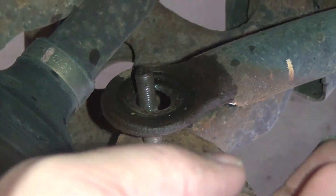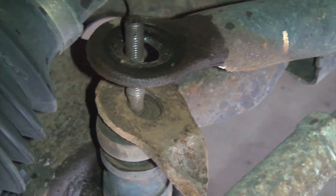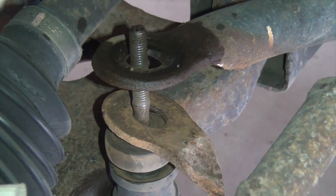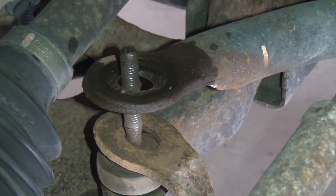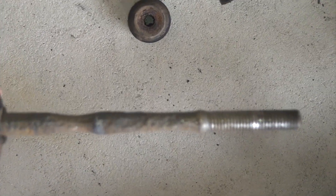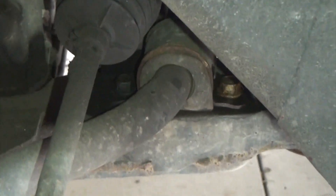As you can see, I've taken this top bolt off and the bottom side of the bar has failed on this side too. Now I'm just going to remove this link — I'll have to hammer that out a little bit, but it should come out fairly easy. It took a little bit of time to get this out. You can see by the narrowing of the shaft right in this area, this is all very corroded and would have probably broken sooner or later anyhow. Here's part of the stabilizer bar that already failed, and here's what it looks like after I've removed the link.